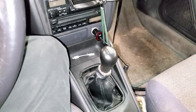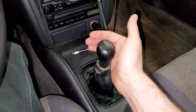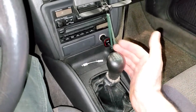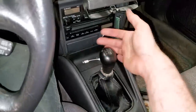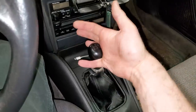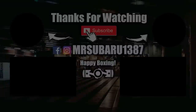Now for the results — I'm not going to end the video without showing you the improvement. Here's the WRX shifter with the poly bushings and new U-joint. Barely any slop compared to what it was before. Nice, tight, short throws — much improved over the factory Outback shifter. That does it for this video on getting all the slop out of your old Subaru shifter. Thank you so much for watching — hope you enjoyed, and I'll see you in the next one.